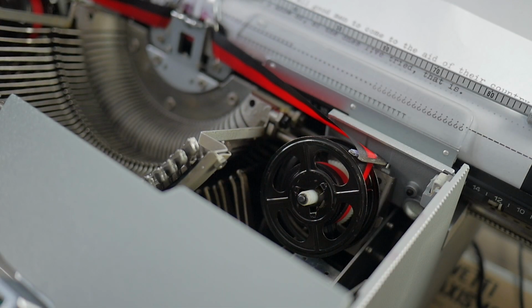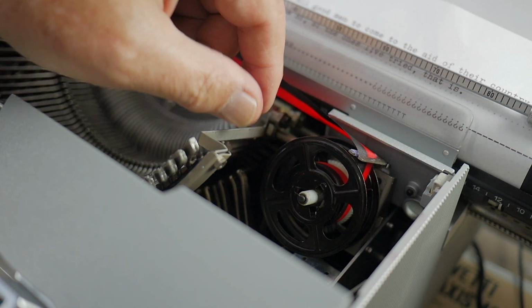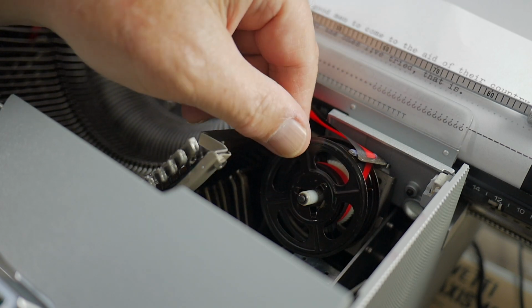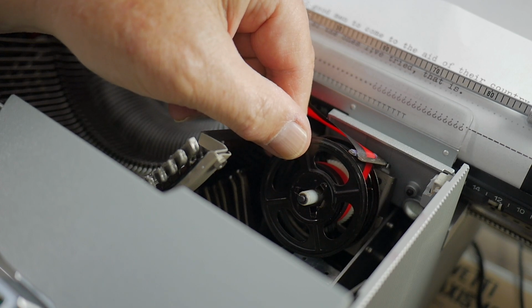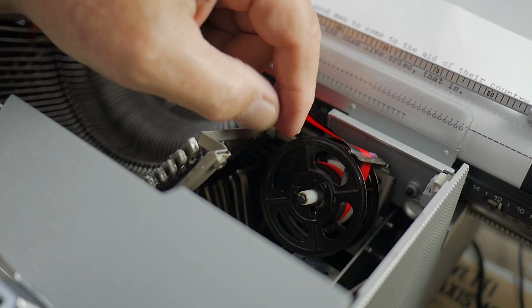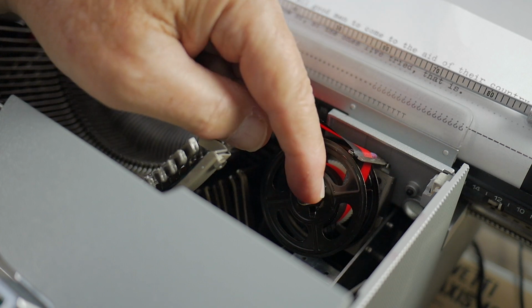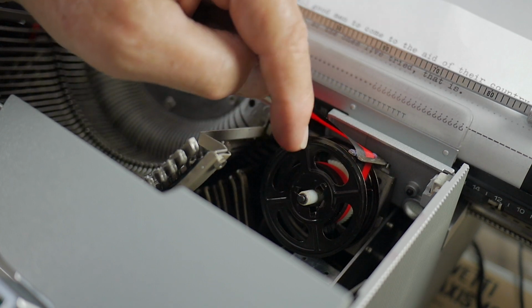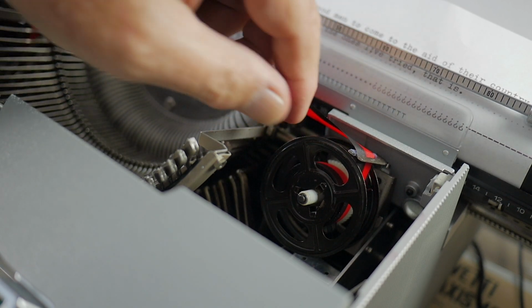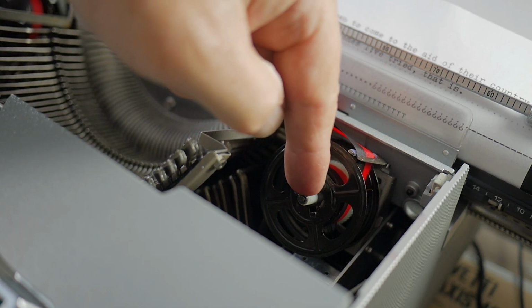The other distinctive feature of this typewriter are the ribbon spools. Instead of being positioned horizontally under the ribbon cover, they're situated almost vertically. They're sitting at a reclining angle, like maybe 60 or 70 degrees. And they use the Olivetti spools with a larger size hole, but instead of using the nuts to hold them on securely, there's a pin on the bottom of this plastic spindle that engages a hole in the spool. And so they don't really need the nuts. And also those brackets on the bottom of the ribbon cover come very close to touching, so they kind of keep them secured in place.